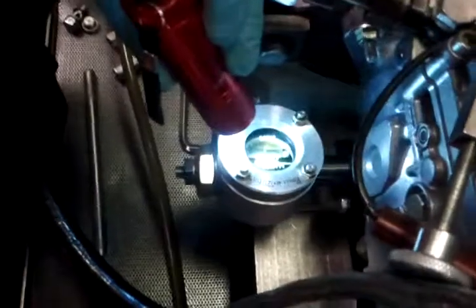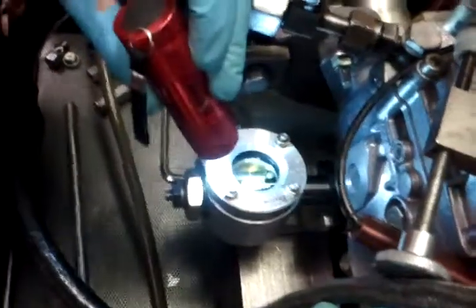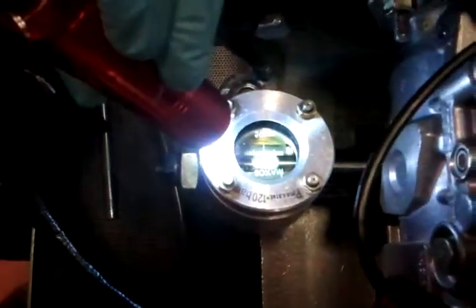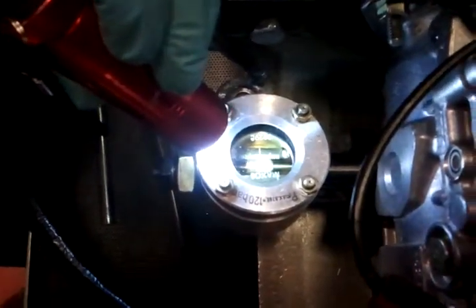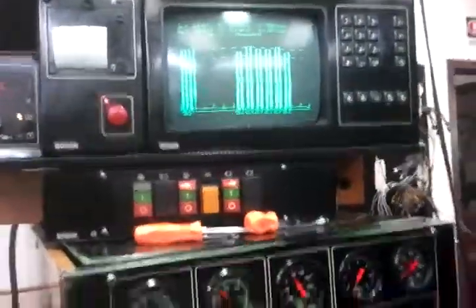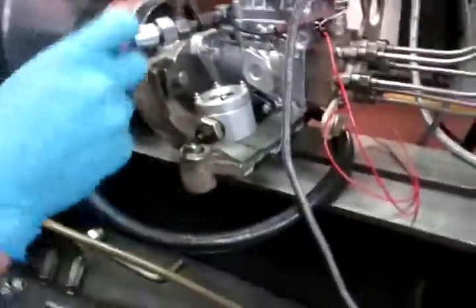So now we're seeing dynamic advance, speed advance, and high altitude combined — you get about a degree and a half. That's kind of up at the top of the range, that was 2150 RPM. That's what ends up at the top of the range — that's the best.